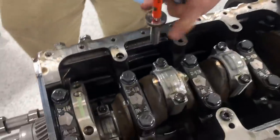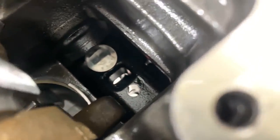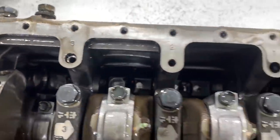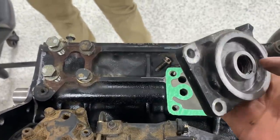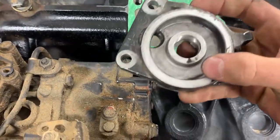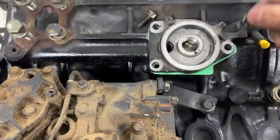Great time to catch this — only two bolts hold the cam in. We cleaned up the tappets, Jordan hit them with assembly lube, and we dropped them right into their bores. They're a tight fit so we used the head of a hammer to gently persuade them the rest of the way in. Also noting that the oil filter housing has a gasket to replace, and I had to buy a new nipple fitting since the old one was destroyed getting it out.